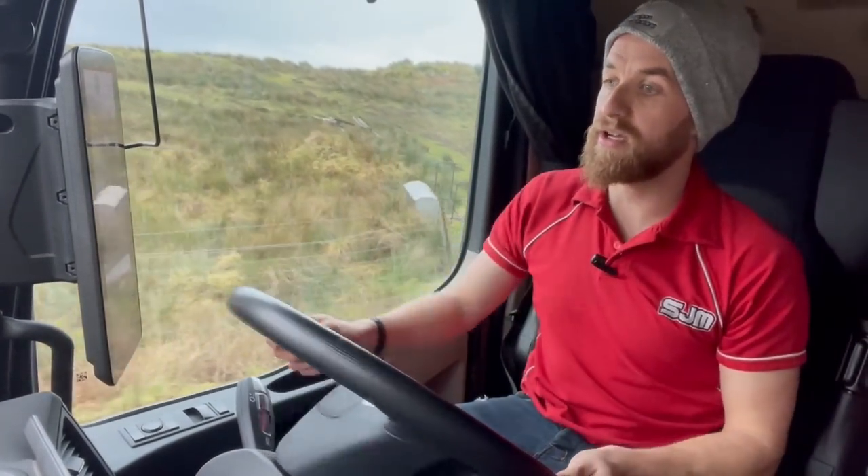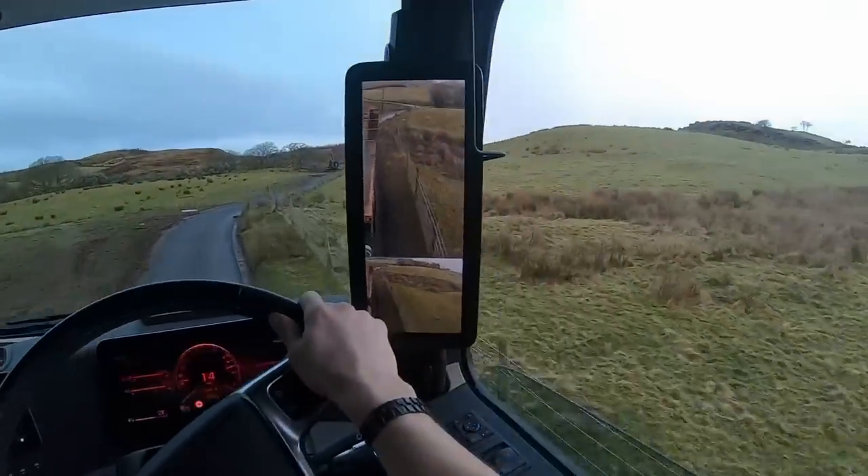Let's get ourselves off the road and open it back up because we've got quite a bit of traffic. This is where the camera mirrors — up our way I'm going to be honest, I don't think they're any good, they're a bit of an inconvenience. However, on the motorway or dual carriageway they're quite smart. When you indicate to go into the other lane, it's calibrated to show you where the back end of your trailer is and it puts a line across to show if there's a vehicle past that point you are going to hit it. And in drizzly weather with a grey car it can be quite hard to tell exactly where they are. On the near side, you get a red box that highlights a car — that is your safety zone, indicating where the vehicle is sitting and if it's okay to change lanes.